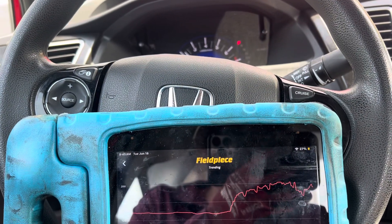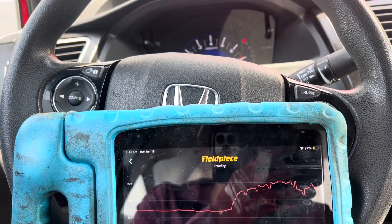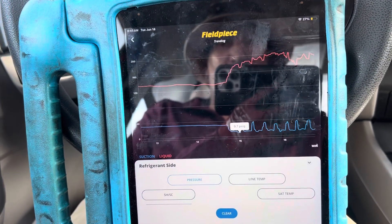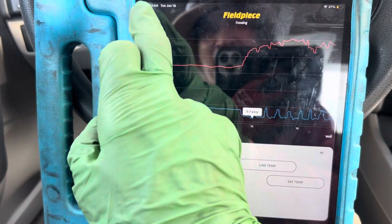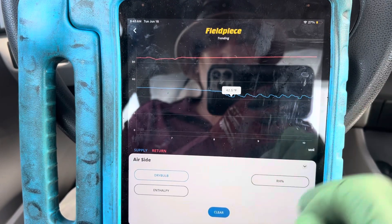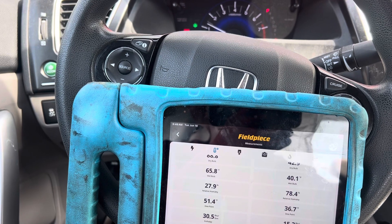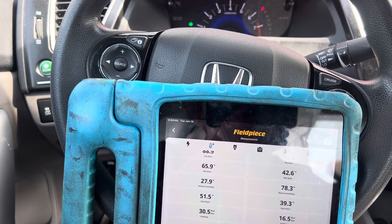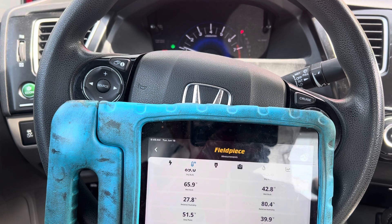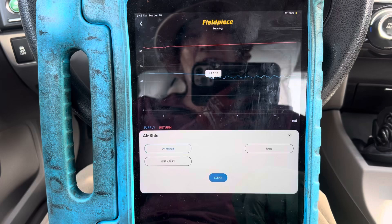You can see as it cycles at 2000 RPMs the RPMs go slightly higher when the compressor cycles off. Let's come back down to about 1000 RPMs — I don't want to go to idle but I want to find a happy medium where it doesn't cycle and stays at its flattest cooling mode. Let's see if we can hold around 1000 RPMs and watch the temperature steady out.